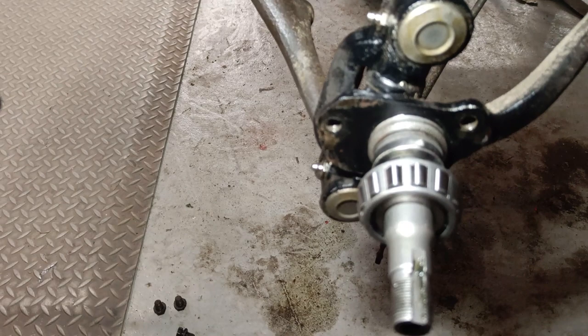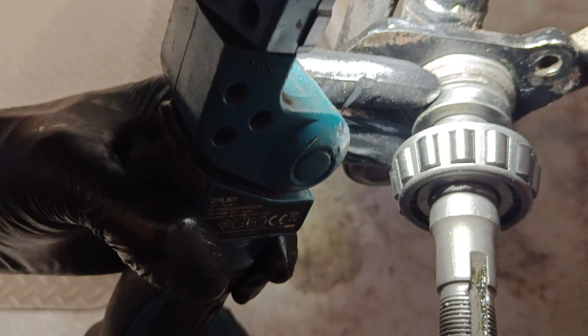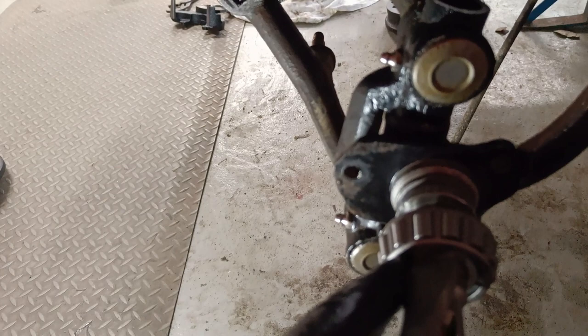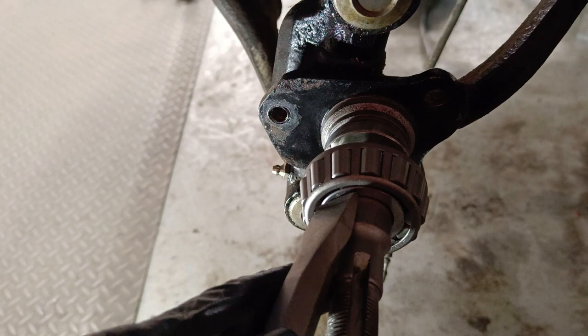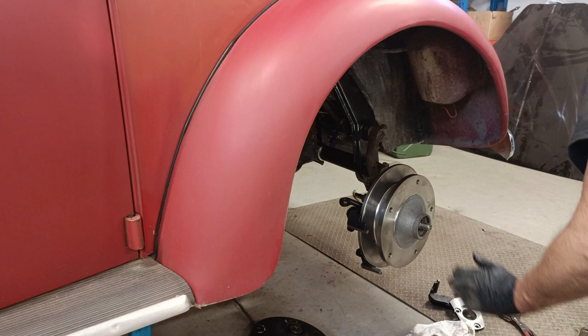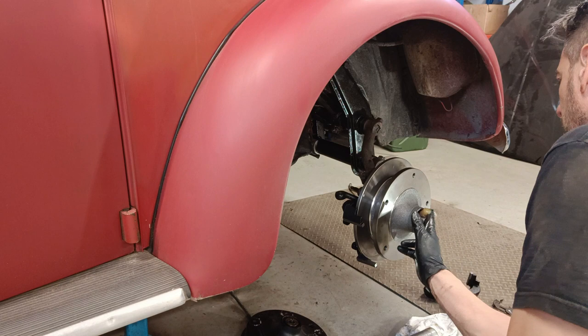Here's the situation — this is the bearing that goes on and I wanted to see what the fitment was like. This is the spacer I put back on, and this bearing stops against that, then leaves a gap between the disc and the hub. I was putting the drift on the inside and knocking this solid piece so I wouldn't damage the bearing — if you hammer the actual disc you're hammering against the bearing, which is no good. Well, maybe I was making a fuss about nothing — I just hit it a little bit harder and it's gone all the way on.